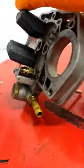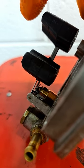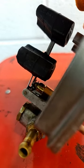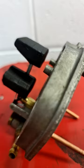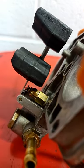It is very, very important to note that you do not press the little ball in the middle down. It has to be sitting on the ball but not pushing it. So we're setting it there — it needs to be set to 10mm — and what you do is you bend the tab up that's acting on the needle valve.